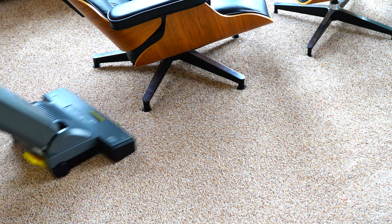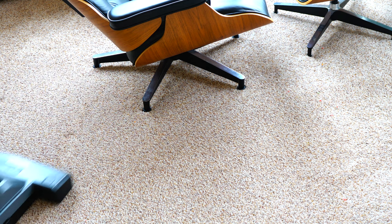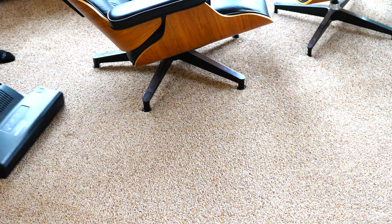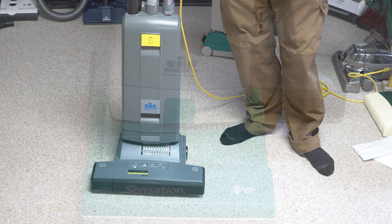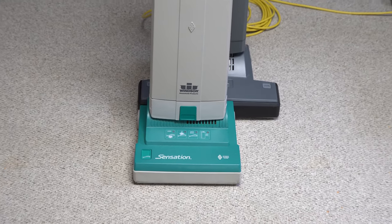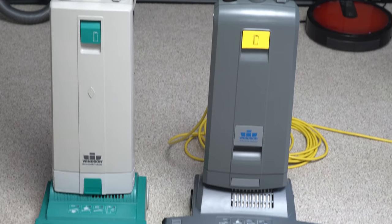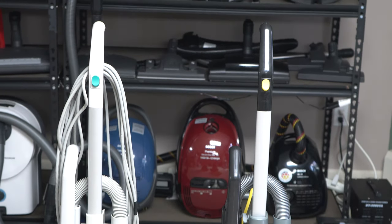I think we'll start with who this is for. This is for somebody who needs to vacuum a wide area of carpet — not hard floor. You would use this specifically for carpet, and you need to do it quickly, but the area is not big enough where you would use an auto scrubber or some of the bigger push-behind machines, but a 12- or 14-inch machine would take too long. This machine has the same motor as the 12-inch and 14-inch machine, which means you do lose a little bit of suction. But these machines have plenty of power to start with, so I don't think it's a huge deal — just something to note.